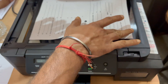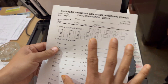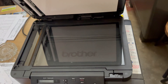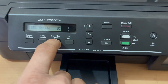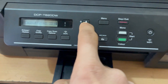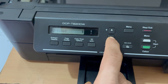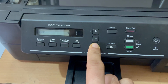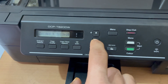If you want both pages printed, go to Copy and Scan options, click the top button, and you'll see the Two-Sided option. Click OK — it's currently set to Off. Scroll down to Two-Sided and select it, then click OK to enable it.